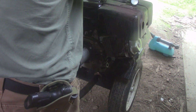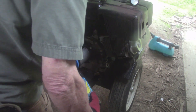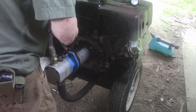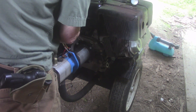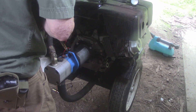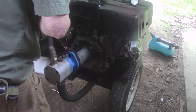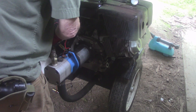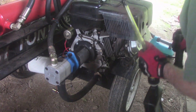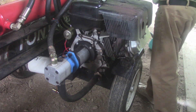We'll put about a half in and see — we'll look in the hole and see what we got. I tend to overfill it just slightly, not a lot, just a little bit, because when I'm out there splitting wood it ain't always sitting level, so I figure a little extra can't hurt. Got to open the valve here. Oil going in. Let's close the valve and let that tube drain a second — we'll take a look in the drain hole and see if we can see oil. Oh yeah, we got plenty. We overfilled a little bit but that'll be all right.